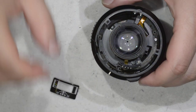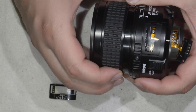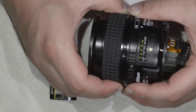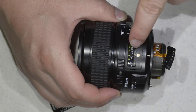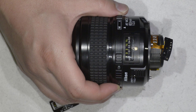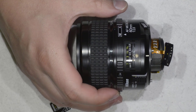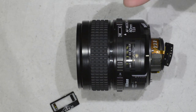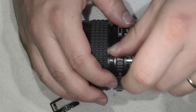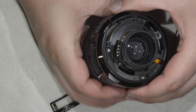You might ask why I'm doing this. The reason is quite simple: when you do the focus and you find yourself in this position, you'll find this little screw here. That screw is the one which is not allowing me to take out the rest of the lens. So I'm going to take a flat screwdriver and take out this very small screw. Once this screw is out, you'll be able to remove this element here and see the mechanism of the focusing.